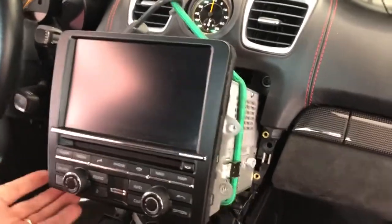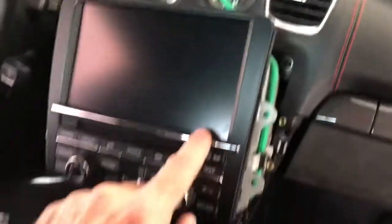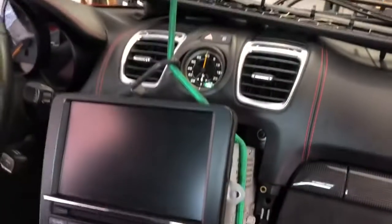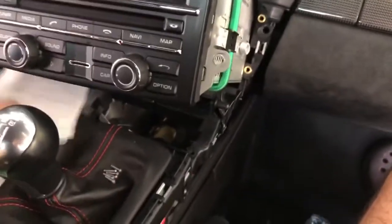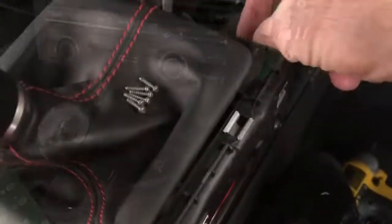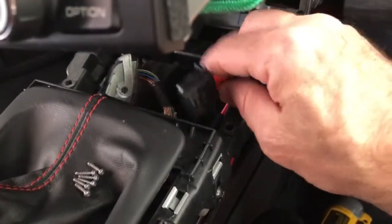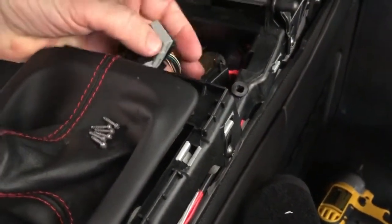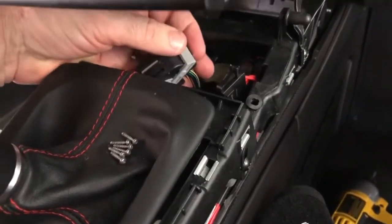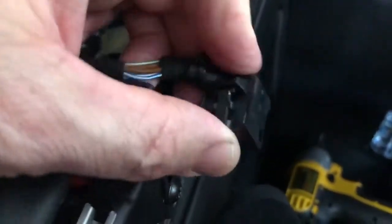I was trying to get the radio all the way out, but I decided to see if I could get this module out without messing with it — I keep calling this a radio module. You can see I have it tied up. I don't think you need to take that out, so you can leave that where it is, but get a rag or something and put it over your module before you get it out. So this goes into the back of the module, and there's a tab on the top and the bottom. You can get your hand in there most likely and grab both of them, and there are also two other cables. Once you get that one, you can pull the module out and have access to this cable. This thing has a little handle connector that just presses in. This other connector has a little tab on it right there — you push in that tab and this will pull off the back of the module.